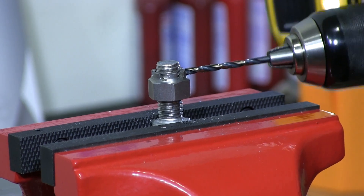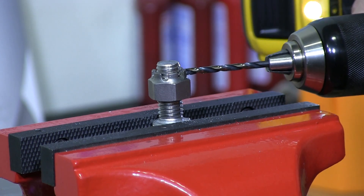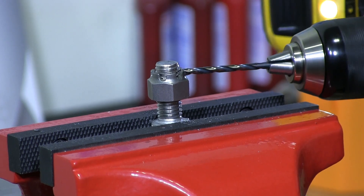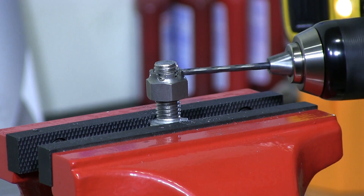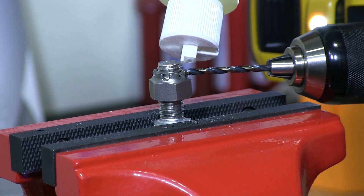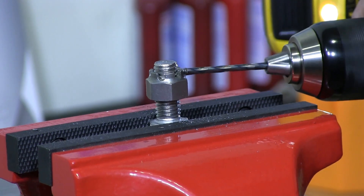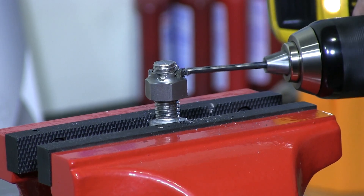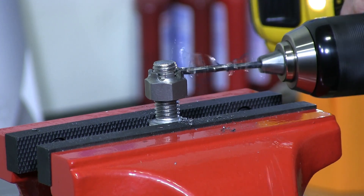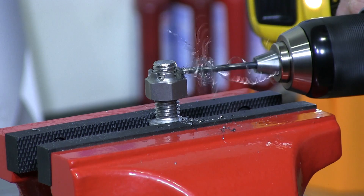What's key here is that you hold the drill level, so when you come out the other side, you come out right where the exit through that prong. And of course I need to add some lubricant — make sure my bit lasts me for a while. I'm drilling stainless steel here, and I'm eyeing straight across the screw to make sure I'm running in the right direction.